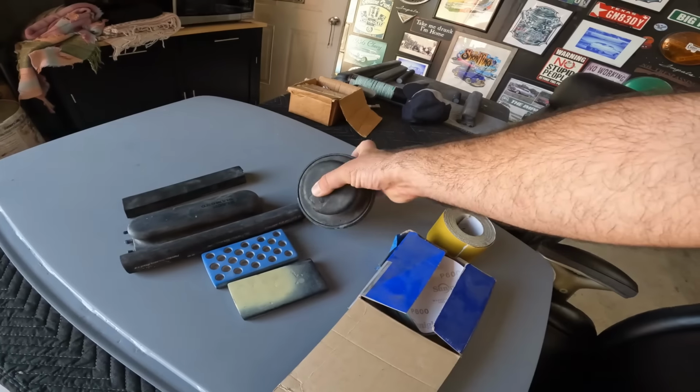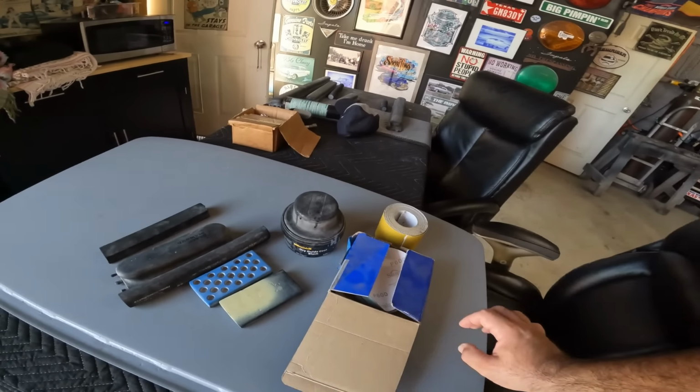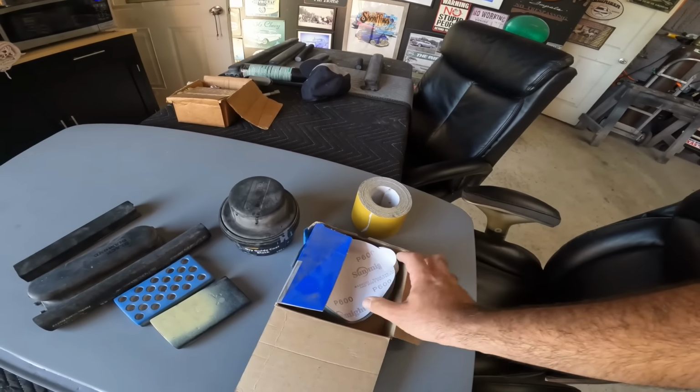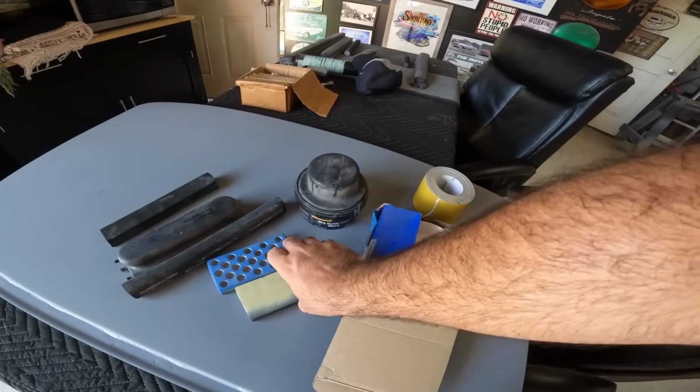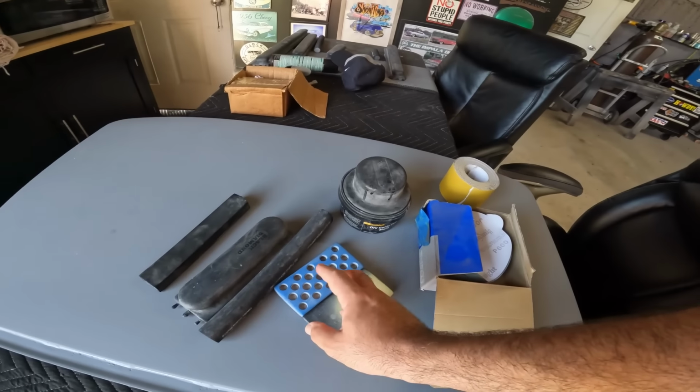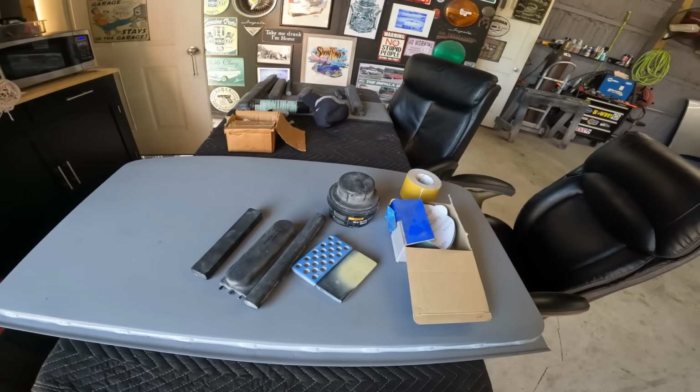We're going to be using Mirka dry guide coat, which hopefully we have enough. We should. We're going to be using some 400 in some areas first. Finish off with some Sunmite 600 on most likely something like this. I do have some Durablocks, some soft Durablocks probably use.